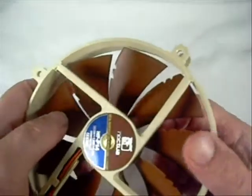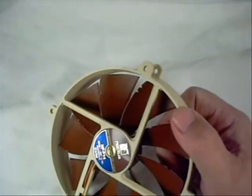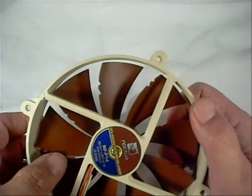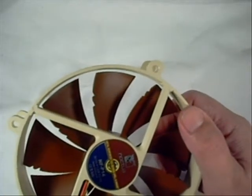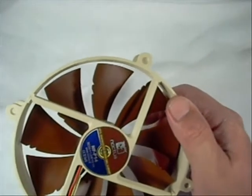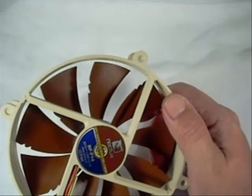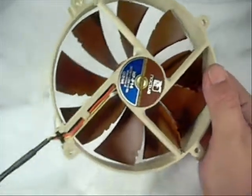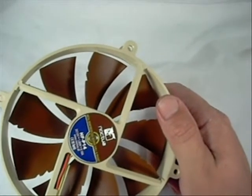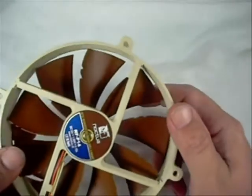You'll notice the notches that are on the fan blades — that's part of their vortex control notches. What they do is basically break up the airflow coming through different spots on each blade, which deadens the noise the fan makes by breaking it up into different frequencies. Each frequency is less noticeable than having it all running at one frequency at a loud speed. That's why most cheaper fans end up being so noisy — they're all operating at one frequency and it tends to be very annoying.